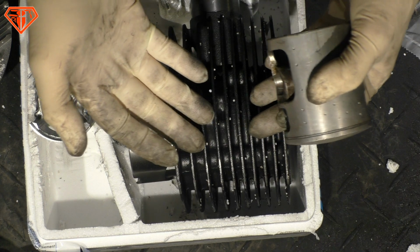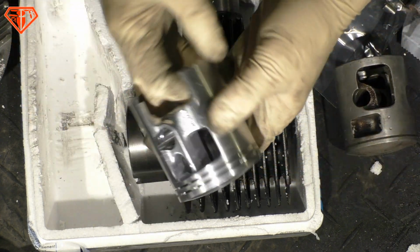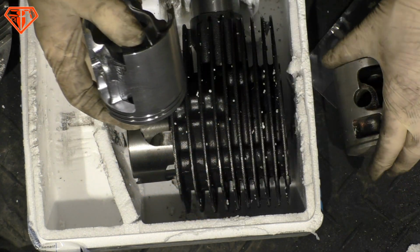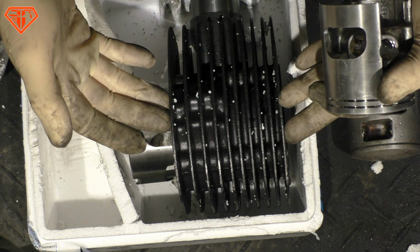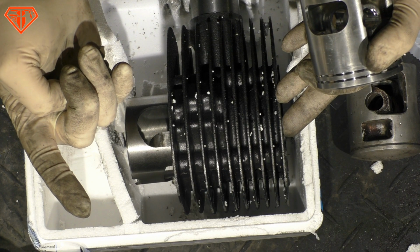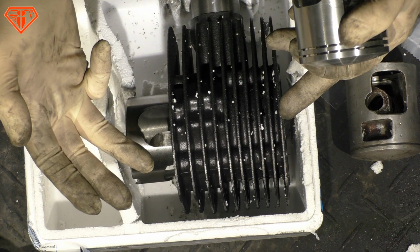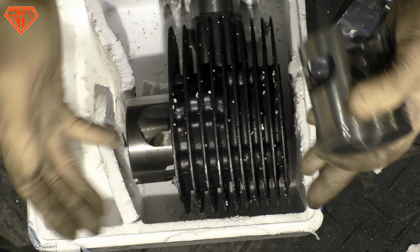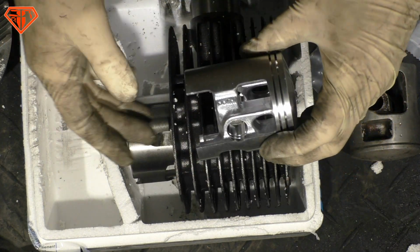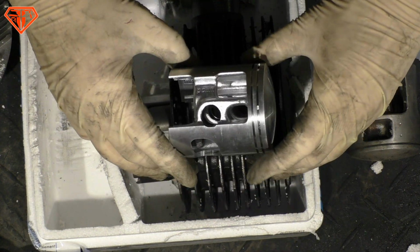We did say if POLINI seizes, you did not properly run it in, break it in. The thing is that this material is much better, the piston is much better, so it won't twist and angle that much like this one. So if you have proper fuel supply, you know, the fast flow tap Zip version 2, not the OGM, BGM, whatever, BS, then the 2.5mm bore in the carburetor and a fuel hose which does not buckle, then you have enough fuel, then you can set the carb correctly, and then you have enough gas mixture in the cylinder that it will be cooled properly. So yes, you can still cut it open, but I don't think that it is needed.